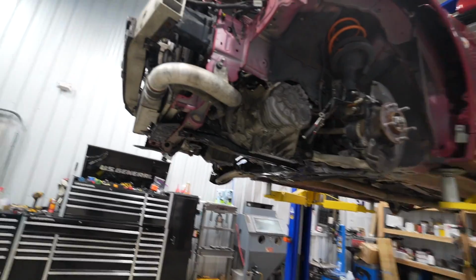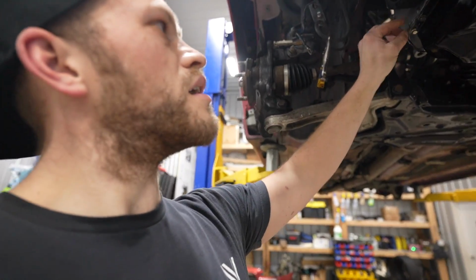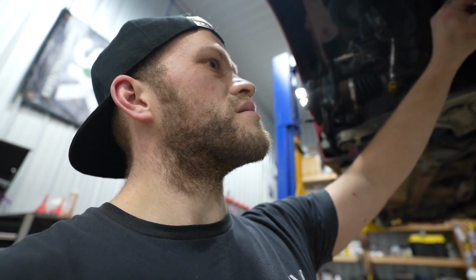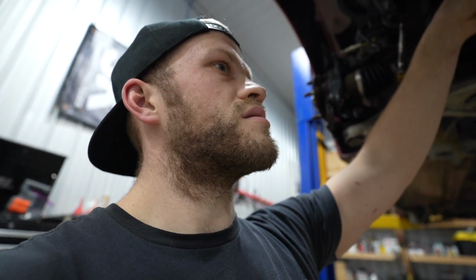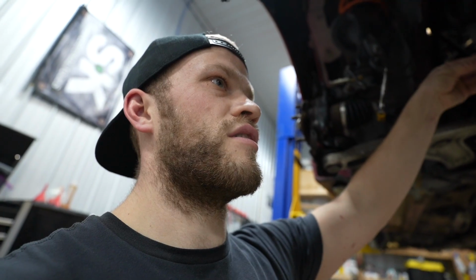Provided it's fixed. How long has that sealant been dry? Well, I was sealing it when you were here last. 4 hours? Didn't you say, because I remember when we did my clutch, you let my sealant dry overnight, and then you did another job. It depends what sealant you use. You built another car, and you were like, oh, that dries way faster than I thought. It depends what you use. So this is 3-bond. They say to let it dry overnight. But if you use some other stuff from O'Reilly's, it dries in like a minute, but then it leaks all the time.